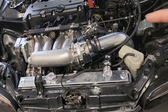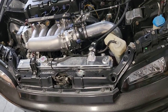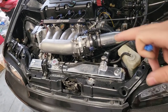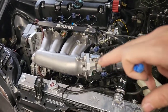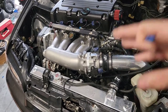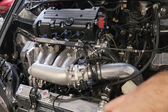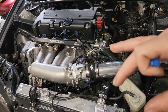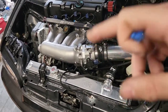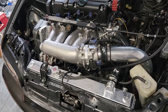I know I still have air pockets in there, so slowly I'll be bleeding those out since I don't have a vacuum bleeder — probably just jacking up the car nose-high again, same thing I've been doing in the past. But there you go, guys — there's a fix for the first-gen thermostat. I know I've seen a lot of bad reviews and myself had a bad experience with it, but this seems to be working. So far, no leaks — thank God. It's opening up; the bottom hose is getting hot, so I know it's opening. I did the three 1/8-inch holes, minus the one I just got the little rivet in. It's been holding. For you guys that are curious and want to give it a second chance — do this. I'm telling you, it'll be way better than getting the stand-style.